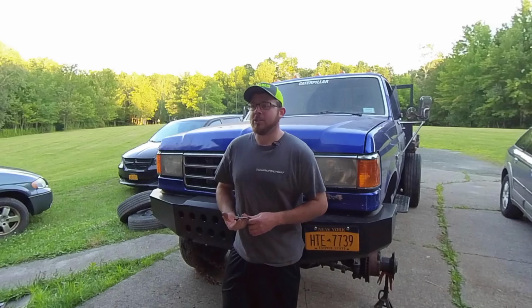The one thing that I do have an issue with is my cooling fan. I mentioned to you guys that I tied into an output from the ECM, one of the spare outputs, and I was going to have it programmed to turn on when the engine was running. Mine is a '99. It's one of the older 3126s, and basically the way it was explained to me is you probably can, but in order to utilize that function, I would have to update my ECM. On mine, the only outputs you could see were the three that were in use. I don't even think you could change them from what they were. You could just turn those functions on or off. So basically what I was told is I would have to update the ECM to the newer software.